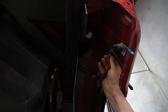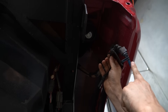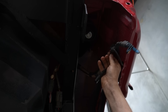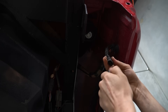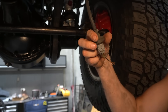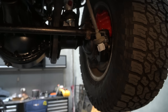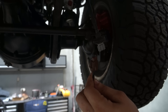The first obstacle was finding the right plugs. If I want to convert from the Touareg sensor to the Patrol sensor, it's best to use the existing plugs. I searched for many hours to find out what these connectors are — you can find an almost-but-not-quite-right one. And then it dawned on me: it's almost like they planned this. The other end on the Nissan Patrol side is where the sensor plugs in, so all I have to do is take the piece I chopped off the Touareg wiring and attach it to a connector I bought off AliExpress — very easy to find. Take note, Volkswagen.